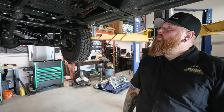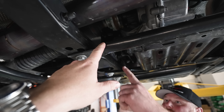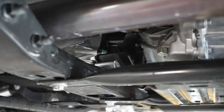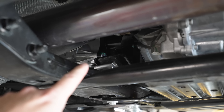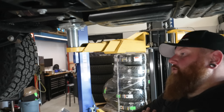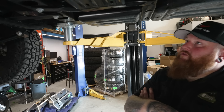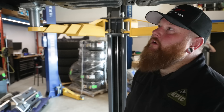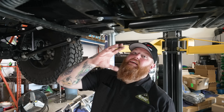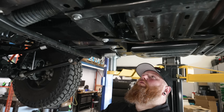This is all part of the kit that you get from AMW as part of your install here at Epic. This is the adapter plate — this is how you connect your version of V8 to your factory Rubicon transfer case. The reason you have to use the Rubicon transfer case is because the other ones don't have a removable nose section. You take off the nose section, the gears get switched over and moved, mount done.